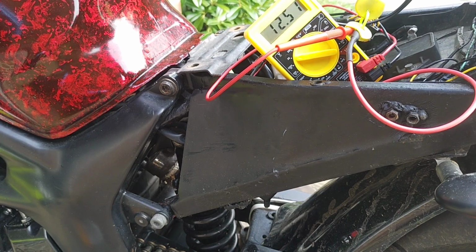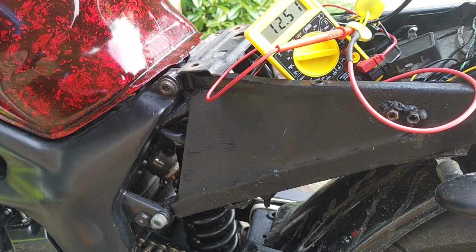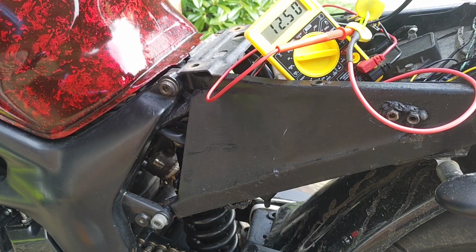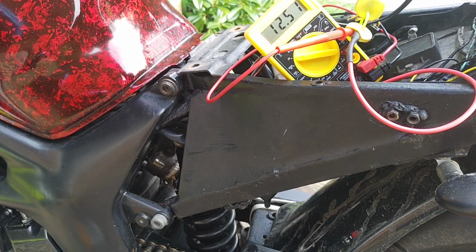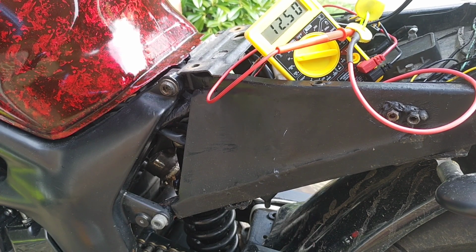and see what happens. So, still got that, excuse my French, misfire. The throttle is still sticking. This bike just doesn't like me. So all the air passages are sorted in there. Changed the coil but not the HT lead, so there's a possibility there. Could even just be the spark plug. I'm sure the air intakes are all nice and sealed now. I did find a couple of issues in there.